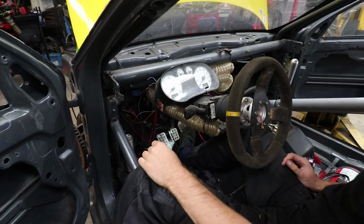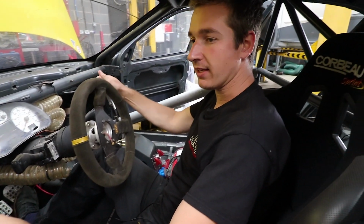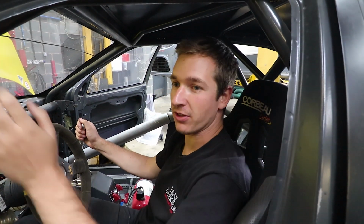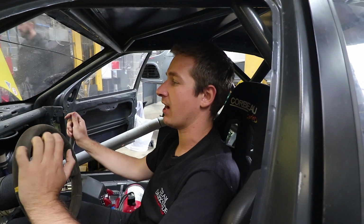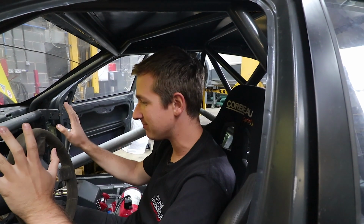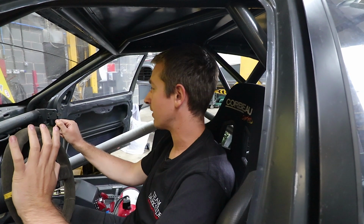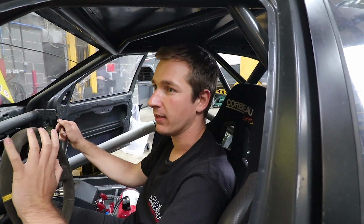There we go. Now, I don't know if you can tell from that video, but it's absolutely shaking the car all over the place. So we're of the impression at the minute that we're going to change them silly engine mounts, even though it puts the engine nicely back and a bit lower down. I think they're going to cause us too much trouble. Before we get too excited, I think we're going to make changes, because a stiff engine mount like that is just going to shake every bolt loose all the time, and it'll not do any favours at all.